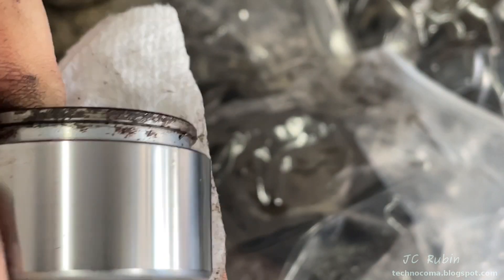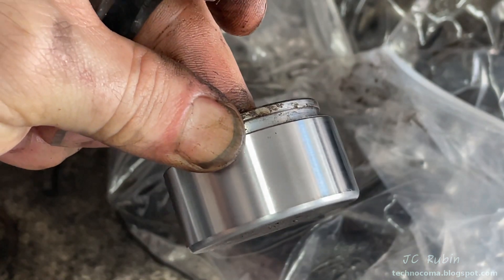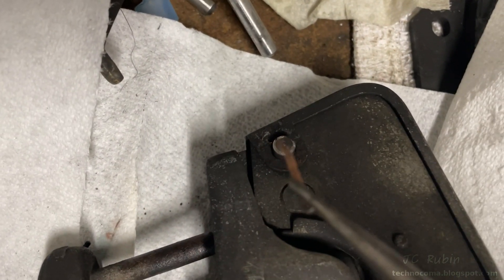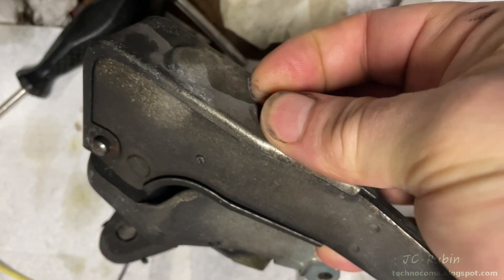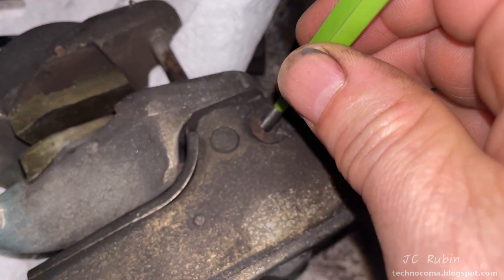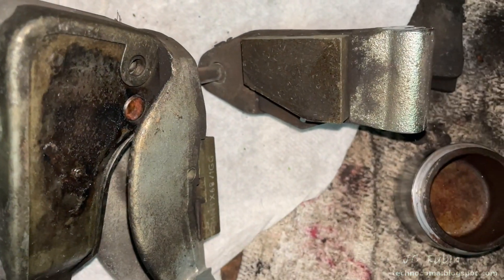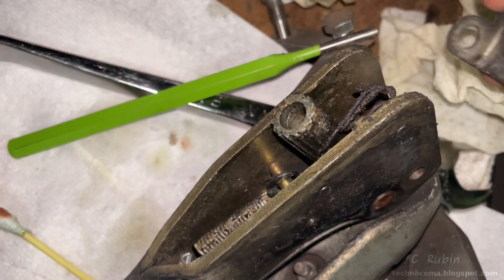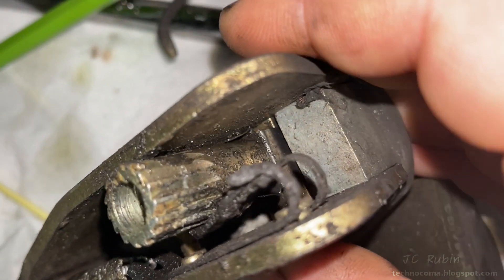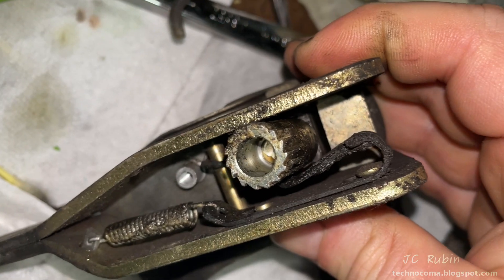That second piston — there's a little dirt but no damage whatsoever. I'm not going to reuse it, but that's impressive. Taking apart part of the e-brake for quick inspection — I removed this pin, this flathead screw, and then pushed out this pin with a drift. I pulled the rest of the way out from the other side, and this cover I could just wiggle off. I can't find my tripod this evening — that's what's going on here. The cover's off and everything in here looks good.